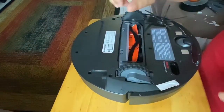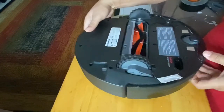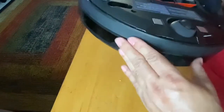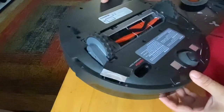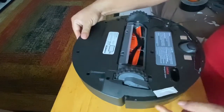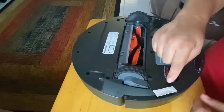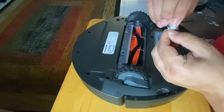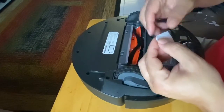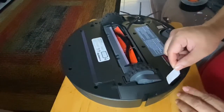One thing I want you to be aware of is this bumper. Since it's laying down, you'll notice it's really not going in and out, but if I lift it, see how it actually flexes — that's when it bumps into a piece of furniture and changes direction. So you want to make sure when you lay out the tape that you don't tape that bumper, because it won't work — it'll prevent it from actually activating the sensors. What I did is put this here as an example: this is what you're actually going to cut out — a piece of cardboard that is larger than the sensor itself, and you're going to place it above it.